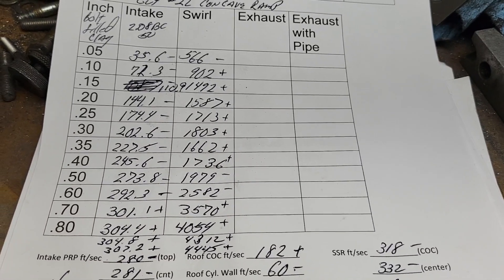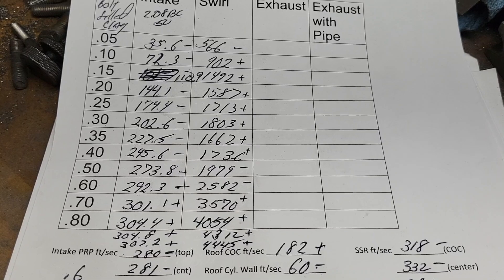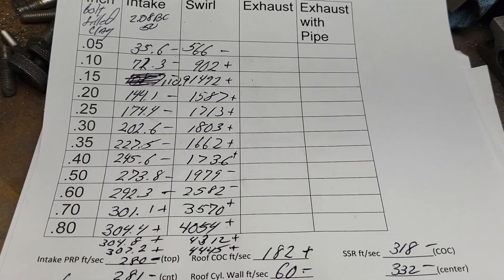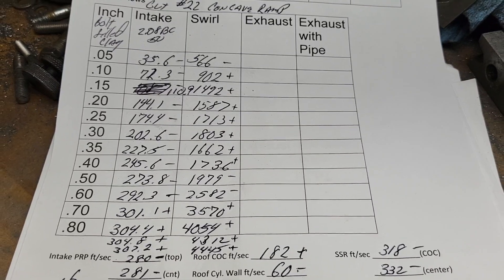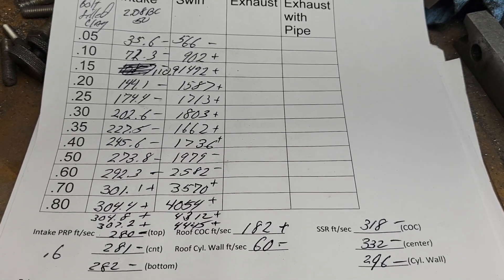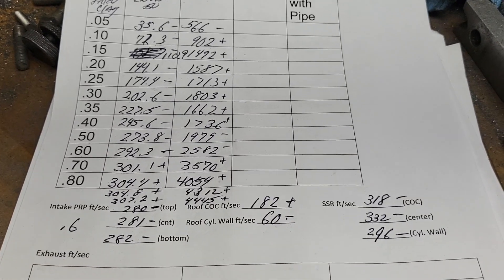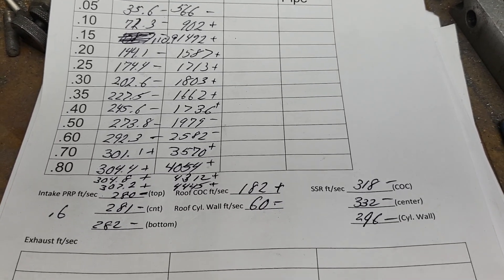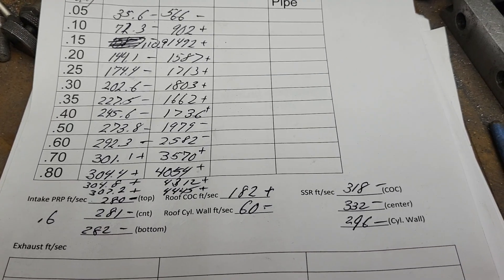If we're pushing our luck over 600 lift we can still make some power with this. I don't think anyone gave me horsepower estimations with that kind of flow versus what we were doing on the exhaust port. The exhaust port — I could still put a bigger port in even if I use a smaller valve; I should be able to get that to rock pretty good. I am worried about our liquid flow, but I don't think it's that bad. I think we just need to keep an eye on it, and at some point I'll review which setup I like best. The one where I had the ramp aimed right at the plug — that was a pretty good curve; I may have to compare those two together.